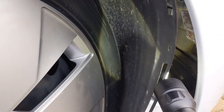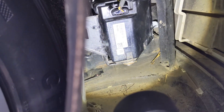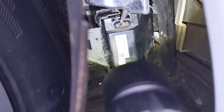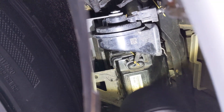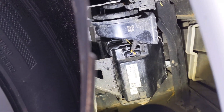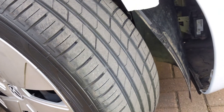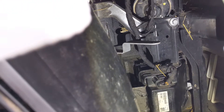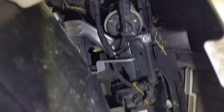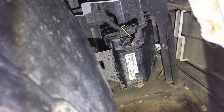I'm hoping I should be able to pull it out this way, but might need to move the tyre the other way around. It looks like there's two bolts at the bottom and one at the top, but I'll also have to move this speed assist sensor out of the way before I can get to the one at the top. I moved the tyre now — it's much easier like this. The first step was to remove the speed assist using a 13mm spanner, and now we can see the sound generator, which we'll now try to take apart.